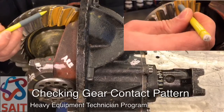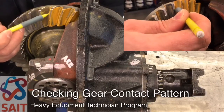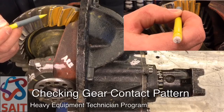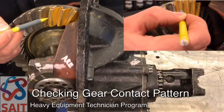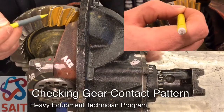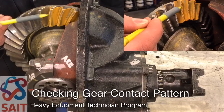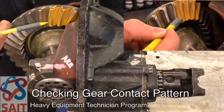Because we have a face and flank issue, that's what we would deal with first. Face and flank is a compound problem — it means our pinion depth is incorrect. We took about 12 thousandths of an inch of shim out; our backlash was tight with that shim, so we put a 25 thousandths of an inch shim back in as the depth gauge directed. But it looks like we're a little bit face on that setting, so we'll pull a little bit of the shim pack out, making it a smaller shim pack, which will move our pattern towards the flank. After that, we'd make our backlash adjustment, bringing the crown gear towards the pinion to move the pattern down towards the toe.